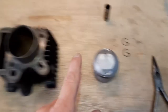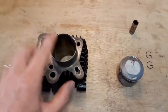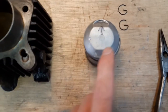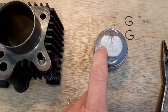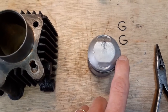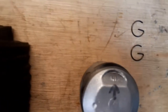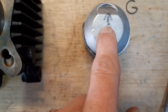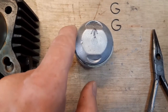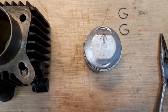About ready to put the piston into the cylinder. The piston rings are in place and kept in place by the cylinder sleeve. An important remark about piston rings — especially the placement of the piston ring gaps. This is where the spark plug is, so this is where ignition starts. I want the gap facing away from that, on the opposite side. The top ring has a gap here, the second ring has a gap here, and the oil scraper ring has a gap facing the top — that's the inlet valve side. Most oil remains at the bottom of the cylinder, so you want the oil scraper ring gap facing up so it's as effective as possible.